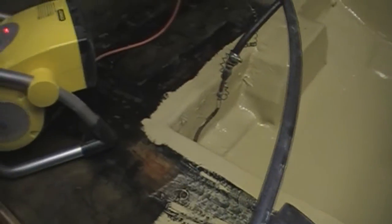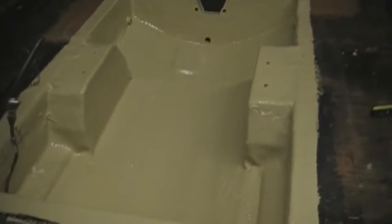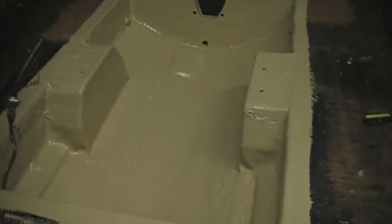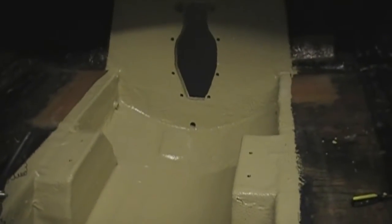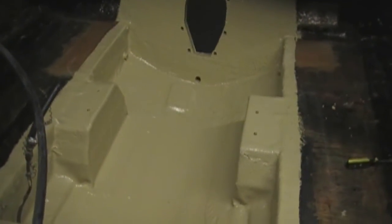I went all inside the holes and around the outside of the little transom hole, and around the backside of the transom a little bit. That's created a basic line here, because this is where I'm going to paint the Rust-Oleum all the way up the sides and all the way back. Behind the transom I didn't want to use the expensive stuff since it's not exposed to the grease and stuff the engine puts out — that's what the bilge coat is for. Anyway, first coat is done and it was really easy to work with.